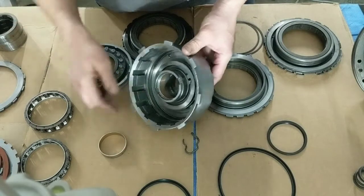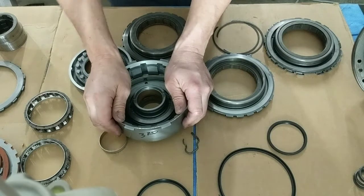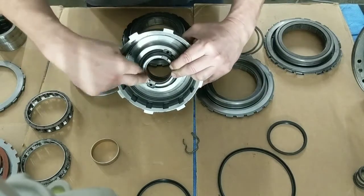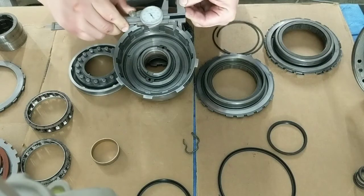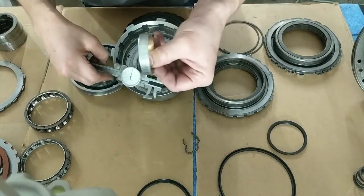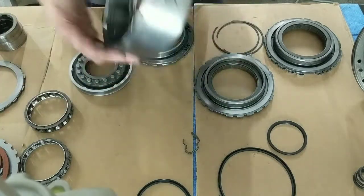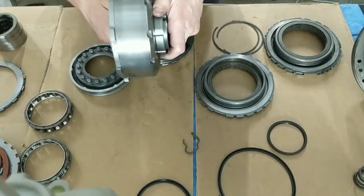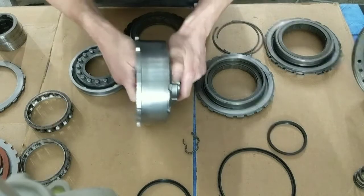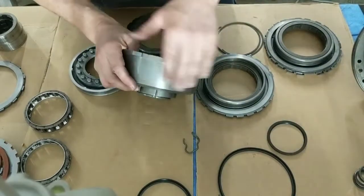This bushing is out of a Ford Cruise-O-Matic. This is a Ford Cruise-O-Matic bushing. Okay, this bushing is 3/4 of an inch wide. 3/4 of an inch wide is right there. Stock 350 bushing, Cruise-O-Matic bushing. What that does is when this drum is spinning, I mean, these things spin fast, it'll prevent it from rocking. That solves that. Also hit this with 1,000 or Scotch-Brite for the outside.